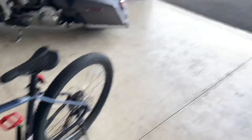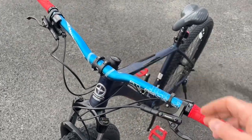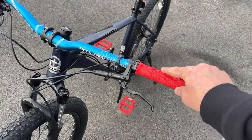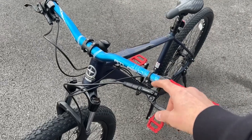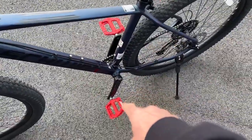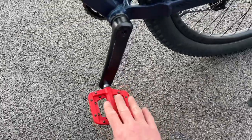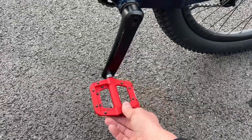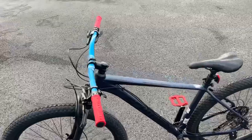I cleaned up and brought the bike outside for better light. Today we swapped out the handlebars with the Race Face Atlas blue aluminum handlebars with a 1.25 inch rise, installed the Race Face lock-on grips, and the Shimano MT200 hydraulic brakes were already on. We also put on the Race Face Chester pedals — they're super nice with spiked bolts that stick out both sides to lock onto your feet, so they won't slip even when muddy or wet. They also have a slightly wider foot pad which is great for bigger feet.